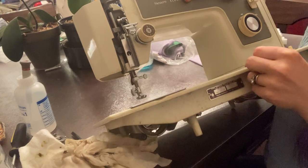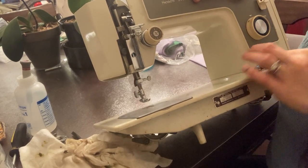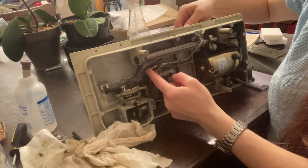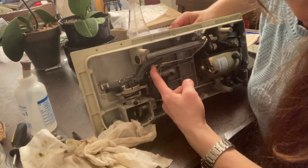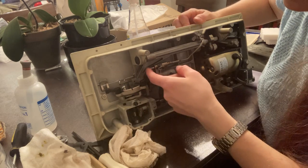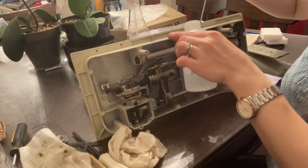This is what changes what causes our teeth to move. This does not move — see that? There it goes. You can force it; nothing's gonna happen, it's metal. But if you cannot force it, here is the part — it is this right here. What you want to do if it's not moving: as you are pushing your lever, you push this back. Oftentimes it's just so packed in there with old grease and it's completely glued — it just needs a little bit of a wedge. Once that's moving, you're good; it doesn't stop moving after that.